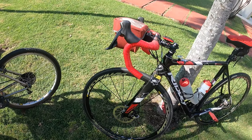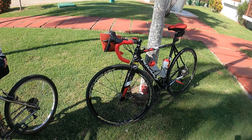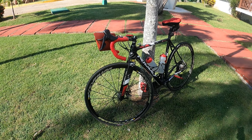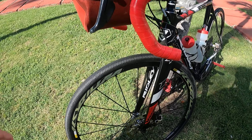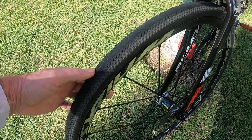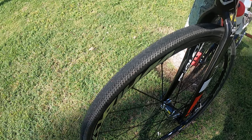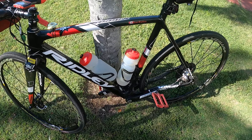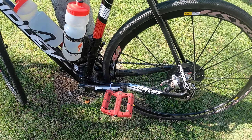My bike is sort of a gravel bike — a cyclocross bike really, but more or less the same thing. It's got disc wheels running 35-millimeter tires at about 45 to 50 psi, which gives a bit of cushioning but still rolls fast. Same nice flat, spinny pedals.